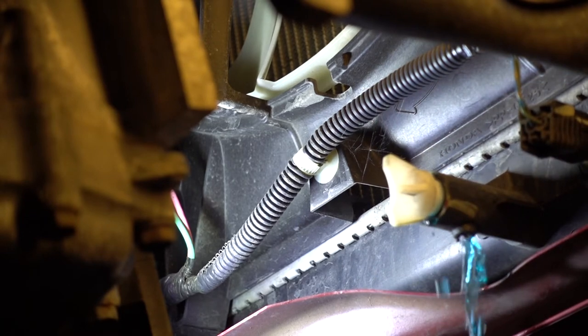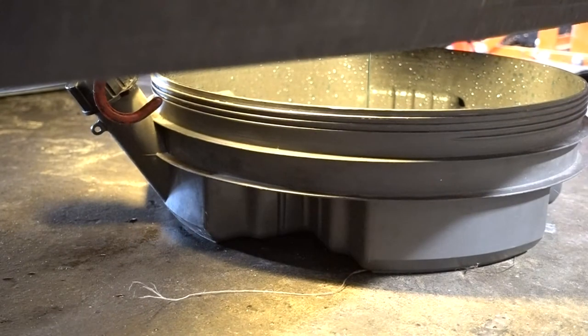Makes it kind of less messy. I was looking all over the engine block to see if it had a drain, and apparently it doesn't — so it all drains from the radiator. I raised the car off the jack stands, removed the jack stands, and then lowered the car so that the radiator would be at its lowest point so I could drain the most coolant.